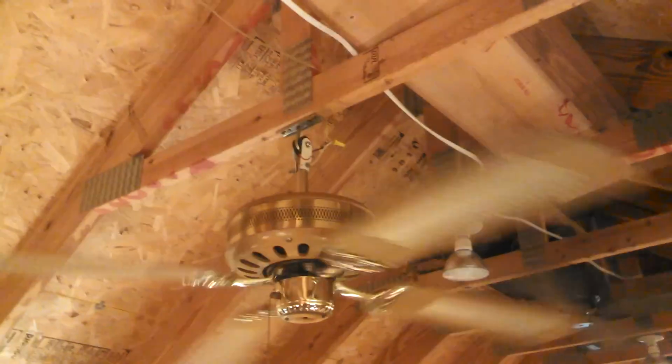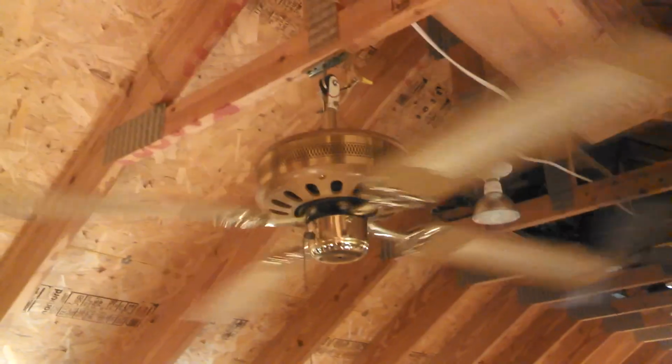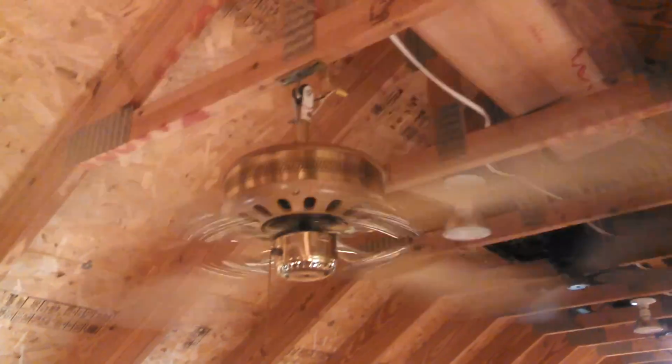It's silent. The thing about SMCs is that even the cheap ones move good air, but some of them hum and some of them have bearing noise, but this is silent. At least on low here, so that's impressive. Okay, off, high, medium. Medium is 0.47, so yep. Low draws more than medium. I'd love to see a schematic for one of those motors to understand why that is.